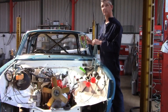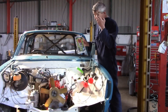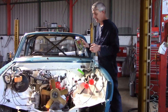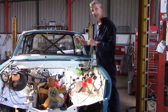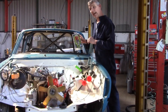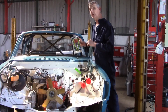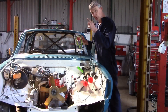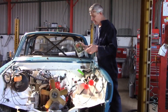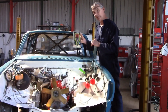When 123 came out with these distributors we must have been one of the first consumers. Very early on we ran the London to Cape Town car on one of these distributors because I was so confident in them. At that time we designed the unleaded fuel curve. What it means is that all that low and mid-range torque you lost by having to retard the ignition for unleaded fuel — you get it back, because timing is good at the bottom end of the curve and retarded at the top, which is what unleaded wants.